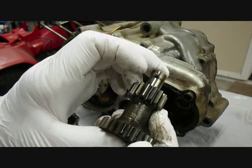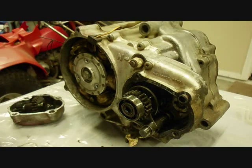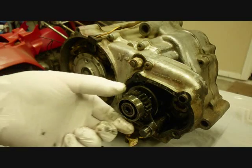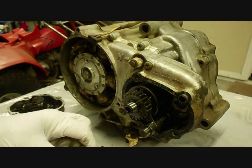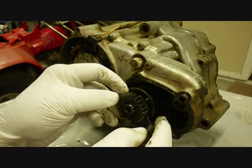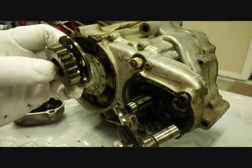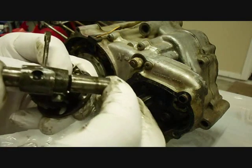There's a gear, shaft, and a dowel pin here. Now we'll do the low speed gear, and it looks like there's a bearing here — I didn't see that in the manual. We'll take the shift fork, the shaft, and the low speed gear off as an assembly. There's the low speed gear, here's the shift fork, and here's the shaft.